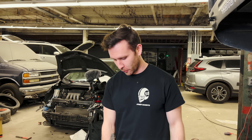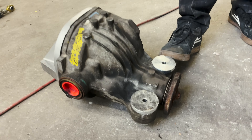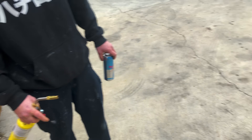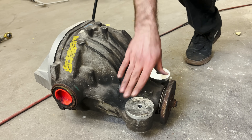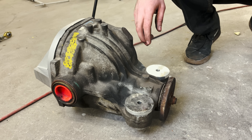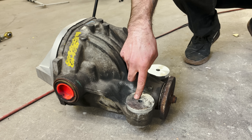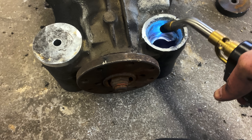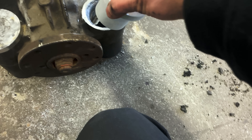I did not mention before, but I did replace the bushings. Greg and I earlier today torched out the old rubber bushings and then I froze the new bushings. This one I did not heat the cup up enough and it went in halfway and then it wouldn't go any farther, so I beat the hell out of it. This one I heated up thoroughly and it slid right in. Take your time.